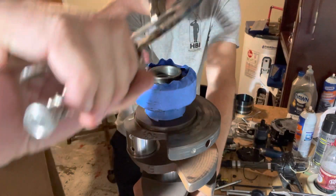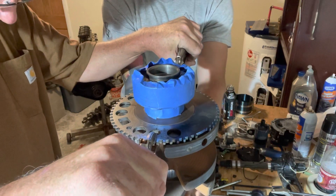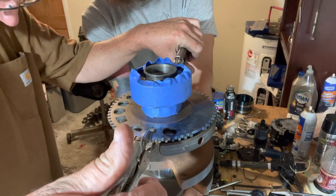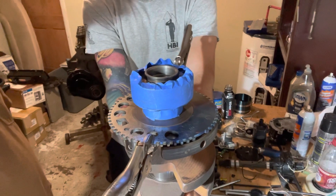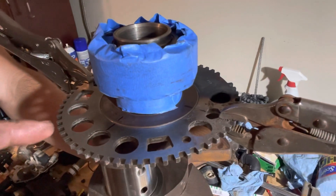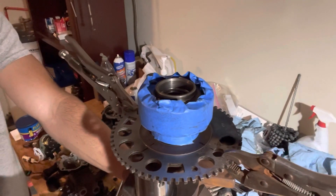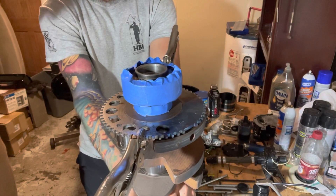We're now about to place this trigger wheel on here. Perfect — hold it right there. It ain't cooled down yet. Okay, let it cool. So we've now placed a 58-tooth trigger wheel on a 2000 LS crank. I made black marks on the wheel before heating it up and I've lined the marks up. I'm going to let this wheel cool down and see if it tightens up against the crank. It was a bit more loose than I expected, so we'll see. I'm not going to touch it — I'm going to let it cool down.